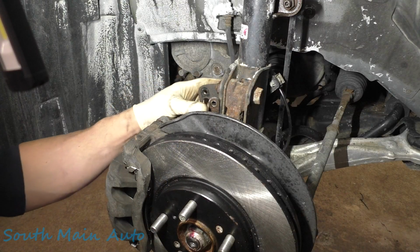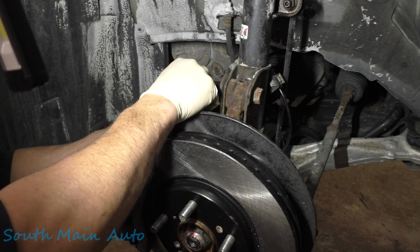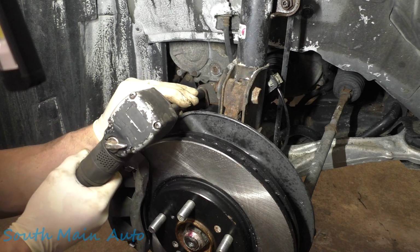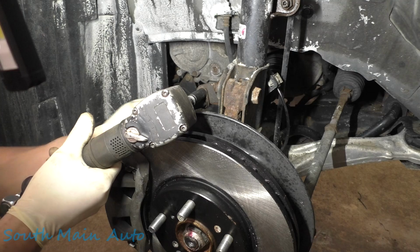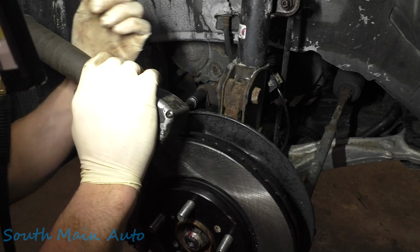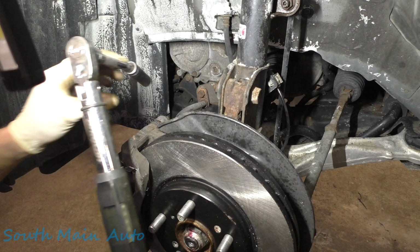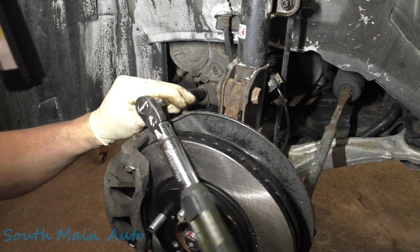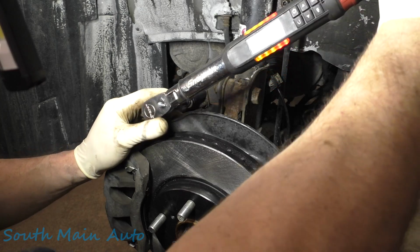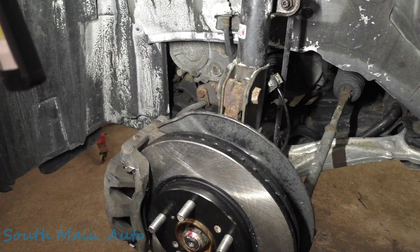And I guess last but not least, the brake hose bolt. Line that fella up. At 16 foot-pounds, or a very light snug-a-dugga, or a quick hugga-dugga, like a, yep, hold like this. That's 16 foot-pounds right there, guaranteed. Let's see how close we were. Let's see if it moves. Nope, it didn't move. It's at least 16 foot-pounds. Probably 19 is probably where it's at.